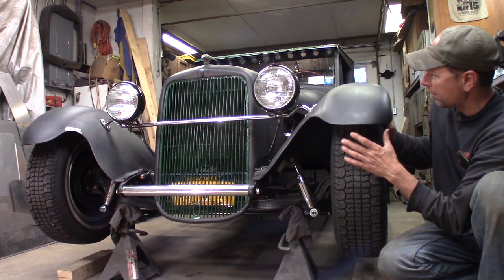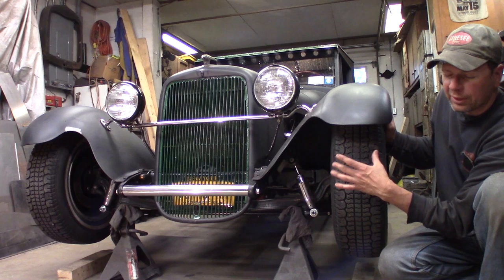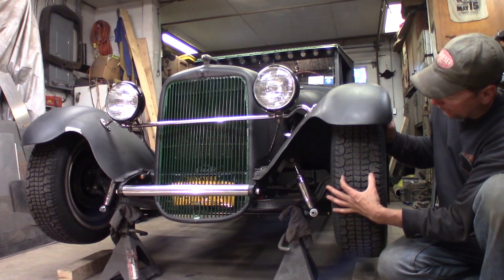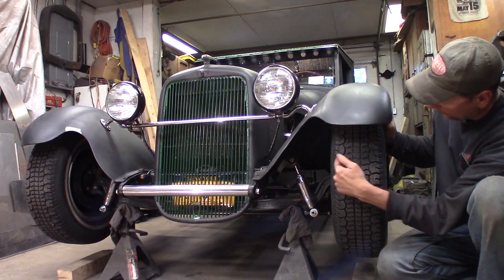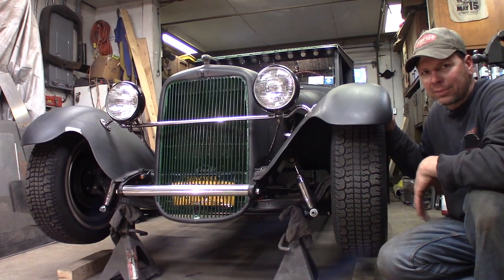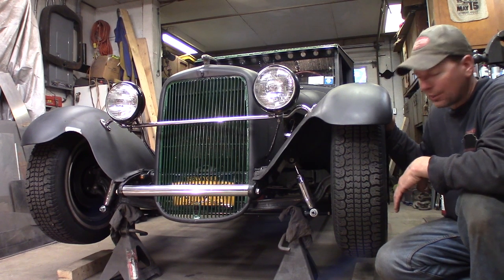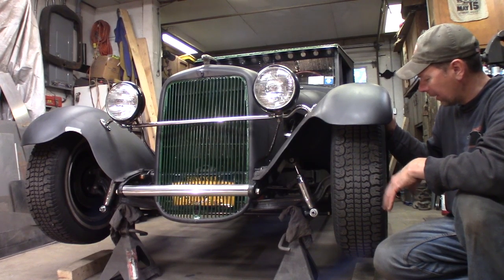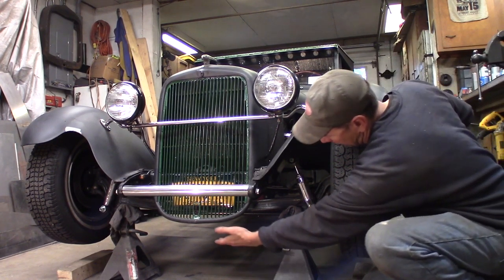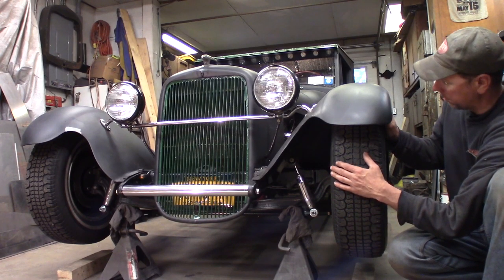I could go to a narrow rim — usually you see a Model A that's really slammed on the ground with fenders on it, they have like a 4-inch wide rim with like a 155-series tire, a small super narrow tire. That would really help because it's rubbing out here. But I don't want to change wheels — buying aluminum mag wheels and two front tires would be like a thousand dollars. I don't want to spend a thousand dollars on this truck right now, and I don't have it. I want to keep these wheels and I don't want to lose height in the tire because the thing is super low to the ground already.